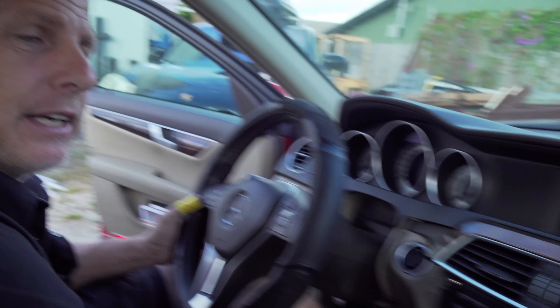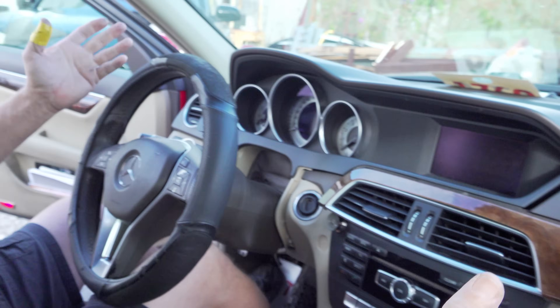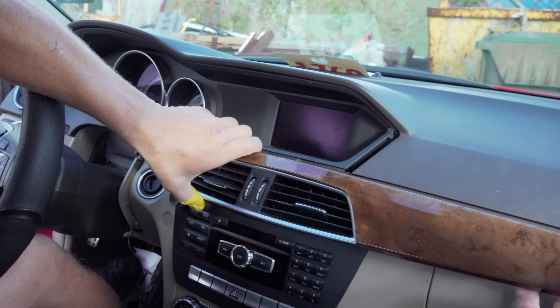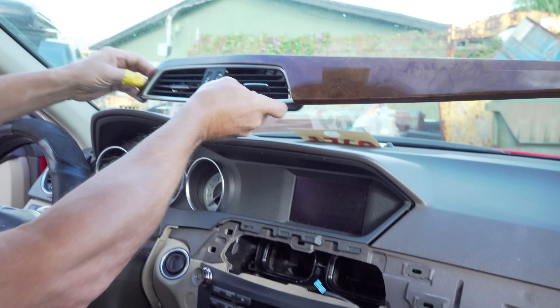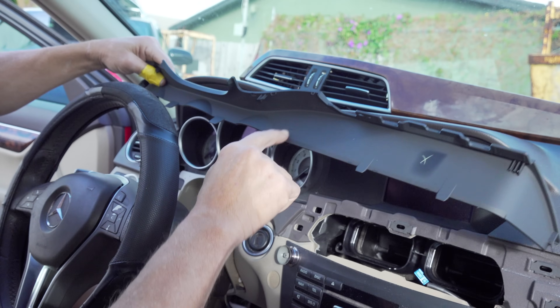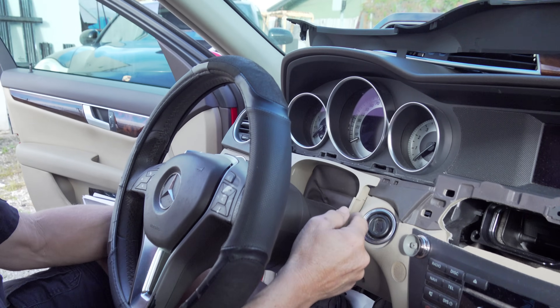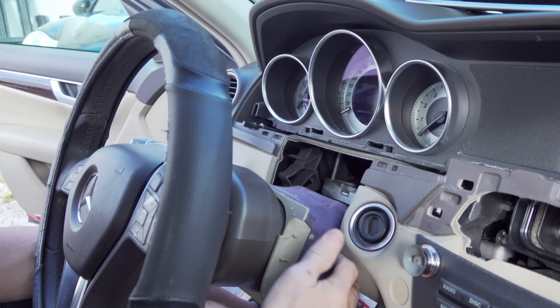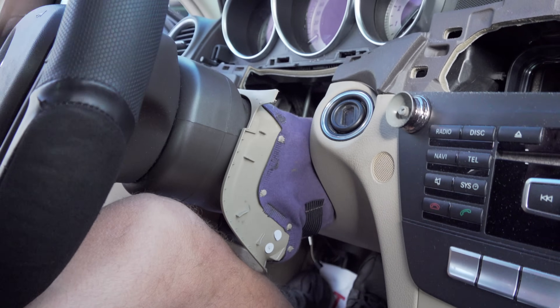We sort of cheated — we didn't know we were going to make this video, and I've already removed the steering lock on this car. This trim is a little different than most and can be a little daunting. You can see in the corner that this trim has already been broken — that was pre-done, not by me. So you take a wedge under here and remove this trim, get it up out of the way. On the AC unit you'll have a plug — just unplug that and get it out of the way. Then remove this lower trim; it slides out toward you. This is the trim ring around the column — pop it out and pull it forward over the column.